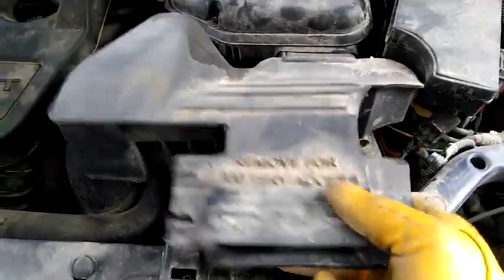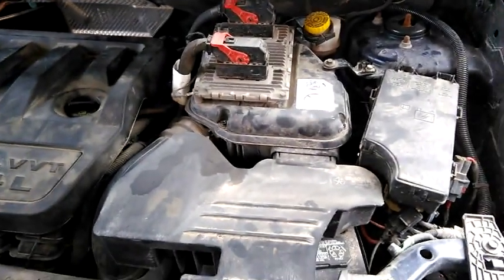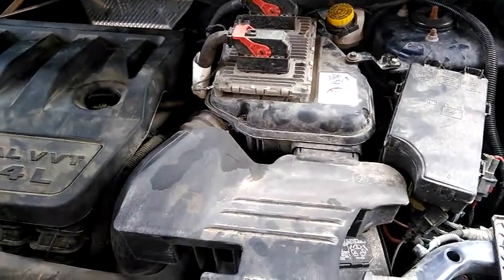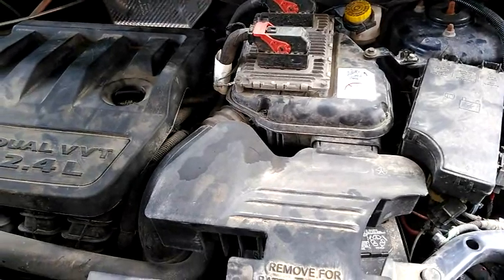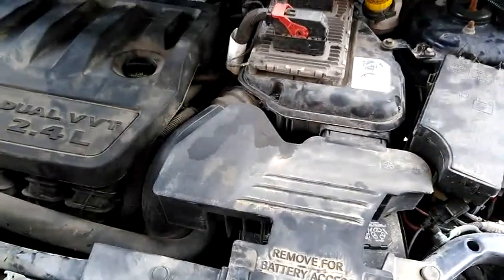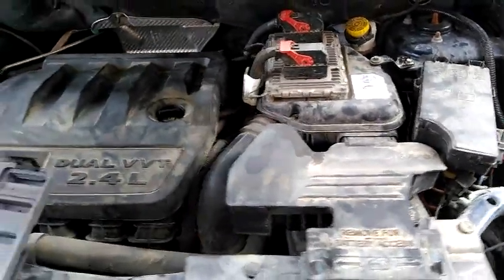Let's just put this back on, slide it into place, and turn these little knobs so it's back down — and that's it, it's all done. You can take off driving again. You should do this every 10,000 miles, or follow whatever it says in your owner's manual for when to change your air cleaner. You can also look it up online. I do it every other oil change because that's about 10,000 miles. Thank you for watching another episode of Mr. Yu's Garage, and we'll see you next time.